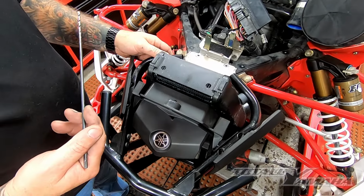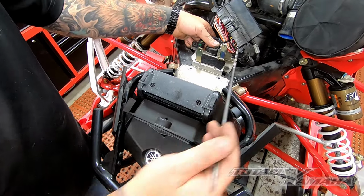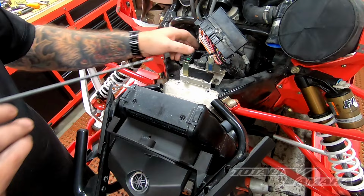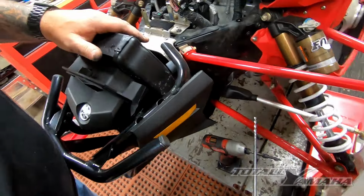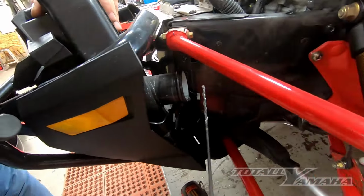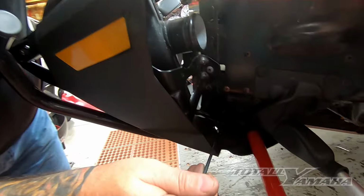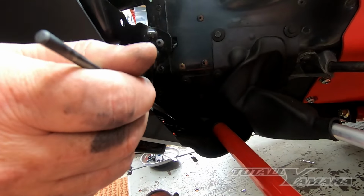So I'm going to pull the front bumper. Then after that, I'm going to pull the little plate that has all the sensors. Those two bolts will be here, and that will be after the bumper comes off. These were pulled off with the panel. Then around the side here, there will be a Torx here, and I think it's a 3/8 down here.